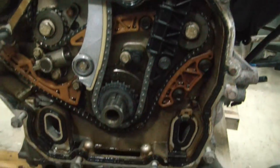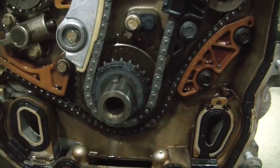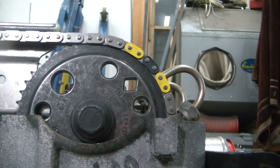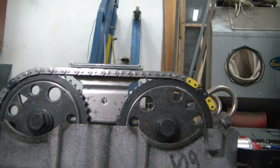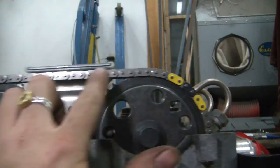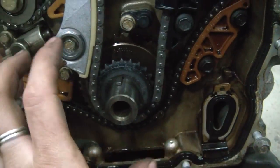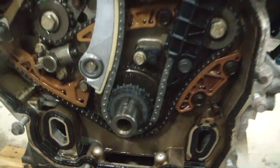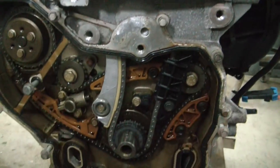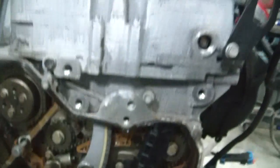I took all my spark plugs out and spun this thing around a bunch of times to make sure I didn't have any interference. One thing I'll say is you can see right now that everything is lined up the way it's supposed to be. But once you spin this around a couple times, you have to turn this thing over and over and over to get these to line back up with the actual marks. You'll get it keep coming around and you'll get it so it's like a couple links off everywhere — all of these points are still in time with each other, but the colored links on the chain move around. That's probably just the way it's divided; you'd have to count all the links and do the math. I thought I'd screwed something up but anyway, that's that.